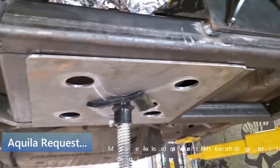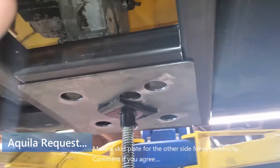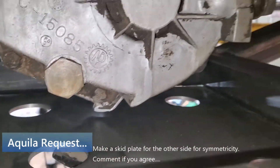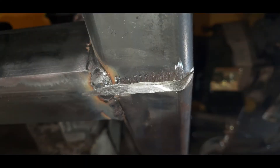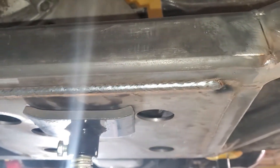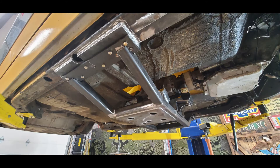There we have the tubes going forward and aft. I made a skid plate, just out of quarter — actually that might be three-sixteenths plate. I put four holes in the corners so debris and stuff can drain out, and then I put another hole right underneath the drain plug so in theory a guy could take that off and the fluid would come out that hole. I had to take the plate down and weld everything that goes underneath it, prepped it and welded it, then grind it flat and put the plate back on. The weld came out pretty good — not bad for overhead with a MIG. That's kind of where we're leaving it off until next week.